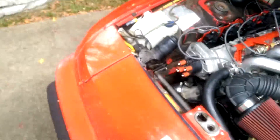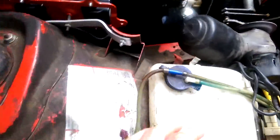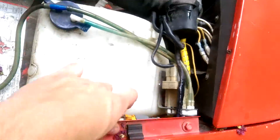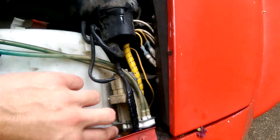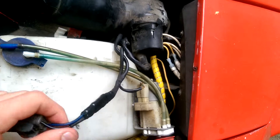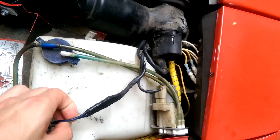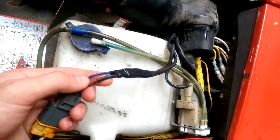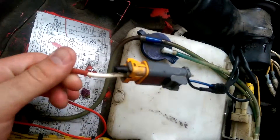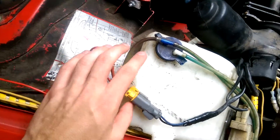I'm going to close all that up in a couple minutes. I finally cleaned up all this over here. The coil is out, and I just have a connector here. This is the factory harness for the coil. There would be two wires - that thicker green wire I showed you, as well as a black wire. The black wire you'd think would be ground, but it's actually the power wire. And that goes through to this wire here, which goes to the main relay, so that whenever I turn the ignition switch, the main relay gets power.